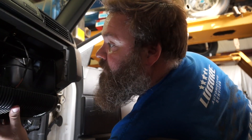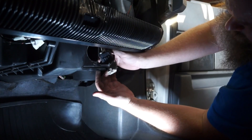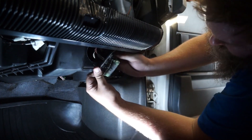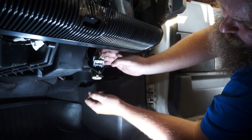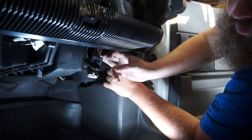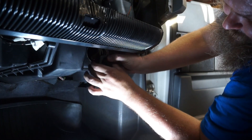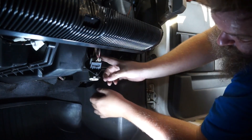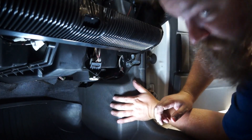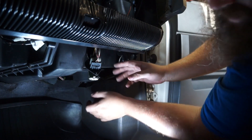This top one is going to be a bit more difficult. There you go — there's my old blower motor resistor. Disconnect all of these pins. You have to be a little finagley to get this thing out correctly because it is a little bit awkward compared to the hole that's in here. So you've got to be a little bit careful — a little bit wibbly-wobbly to get it out of there.